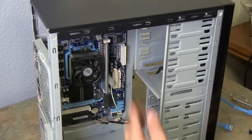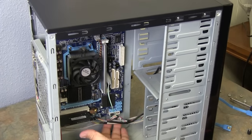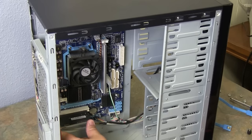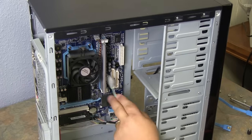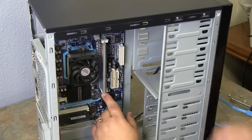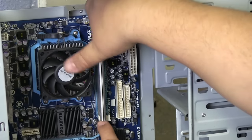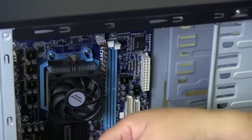Now to remove the system board, you first have to remove each one of the components that are tied to it — cables, PCI connectors, PCI Express, or whatever external add-on cards you have. This is considered memory. It doesn't necessarily have to be removed when you're removing the motherboard, but you can. To remove the memory, there's a tab on either side — you pull the tab out on both sides and the memory slides right out. There's your memory stick.